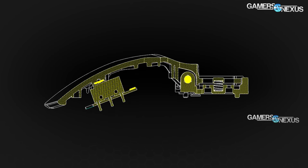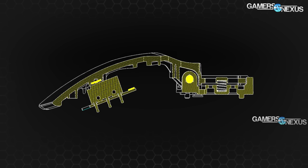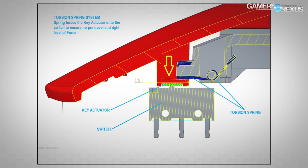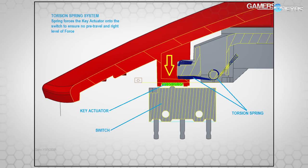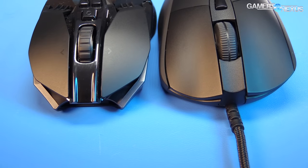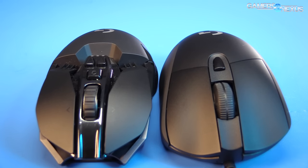The G900 — the $150 mouse we said is the best we've used — has a pre-travel spring to keep tension on the switch and a PCB mounted at an angle so that clicks are perpendicular to input, not a shear input you don't want. When you push the buttons anywhere on the key plate, it's pretty linear in how you perceive the actuation. The G403 and G Pro change this — neither has the pre-travel spring nor the steel pivot bar. Instead they use plastic deformation elements connecting the key plate to the housing that deform on button press. This is less sophisticated than the G900 and doesn't distribute force as evenly across the key plate, but it works better than some competing mice.